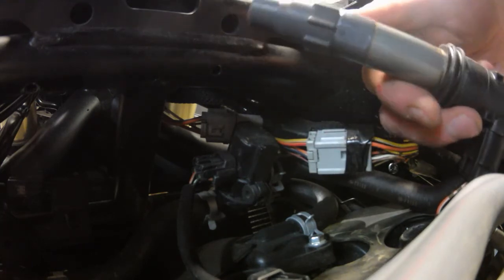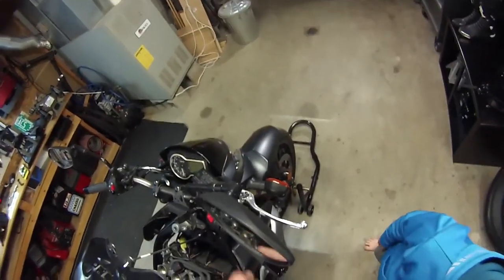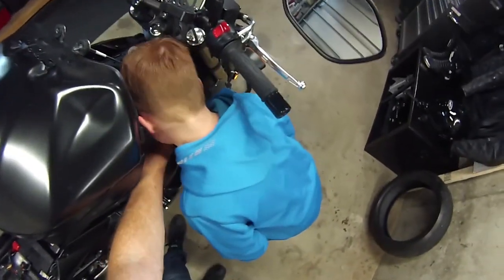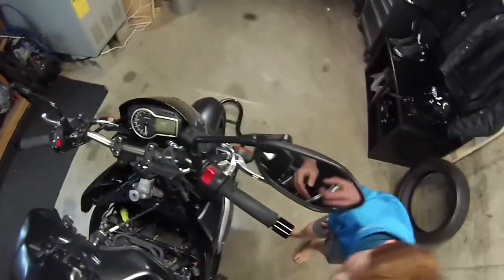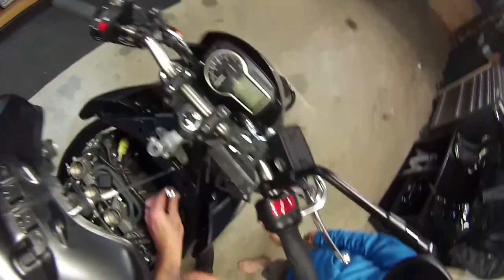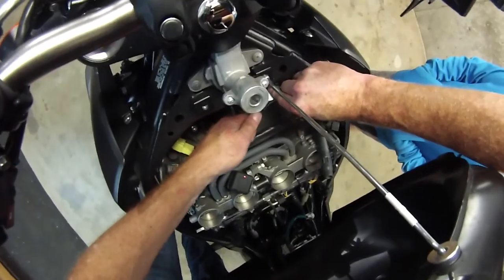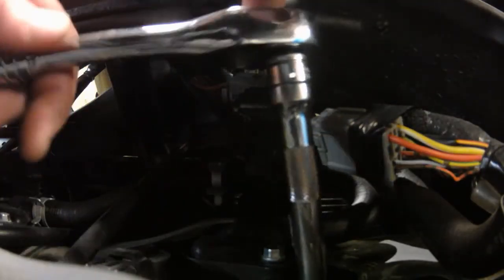I just work on one cylinder at a time — I don't try to get multiples out, just one at a time. Inspect it, looks good. Now we're going to reach down that hole and loosen it up. This is where the air goes in when you open the throttle — air and fuel go through here into the engine and out the exhaust. Down in this deep hole at the bottom is the spark plug. I'm going to stick this tool down in there, remove the old spark plug and put new ones in. What are spark plugs for? They ignite the air and fuel mixture. Now spark plug's loose.